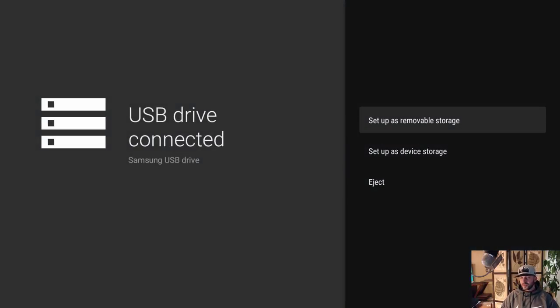I'm just gonna click it and set it up as device storage. If you set it up as removable storage, that's okay too — you can disconnect it, put movies on it, plug it in and watch them. But setting it up as device storage basically takes your regular Shield and turns it into more of a Pro size Shield depending on how big your solid state drive is. If you're using an external hard drive, definitely get a USB 3.0 — USB 2.0 is gonna be too slow. I recommend Samsung SSDs; I have a T3 here but they now sell the T5s. Around Black Friday you can get a 256 GB Samsung SSD for around $100.